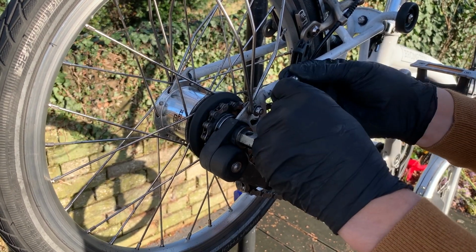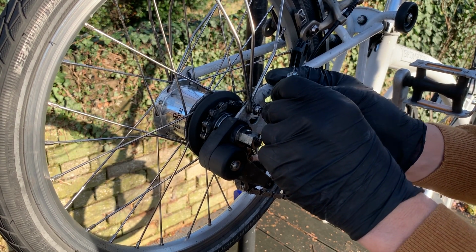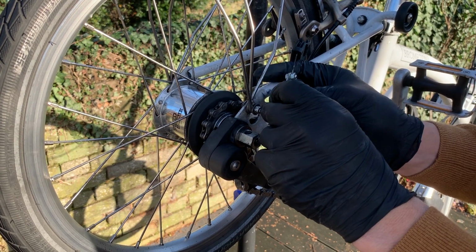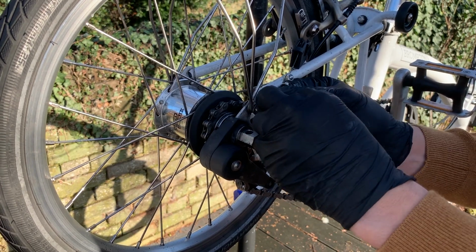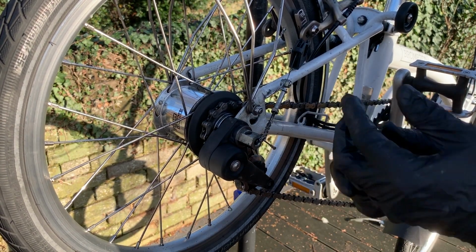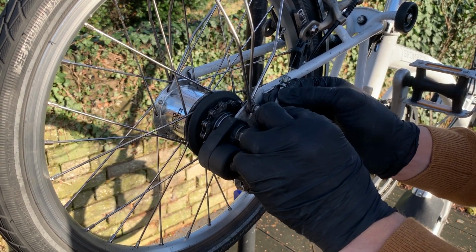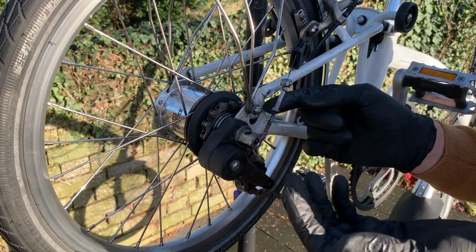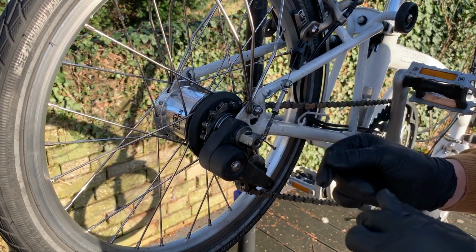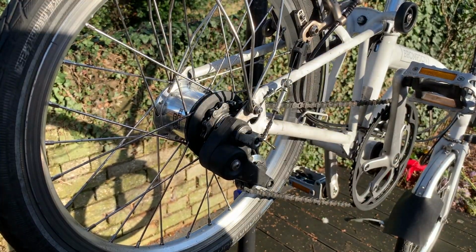which I need to just give myself some slack. So put it in top gear, which is its natural gear, and then this. Incidentally, if you do lose adjustment, the very, very rough and ready rule of thumb is that in top gear the system is slack but with no play, so it's just slack like this. The more accurate adjustment is if you look through the top here. It's actually worth having a look.